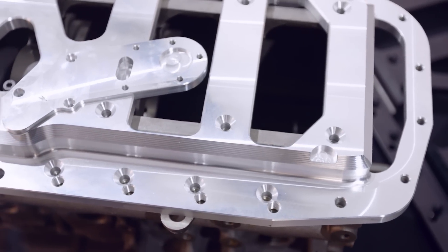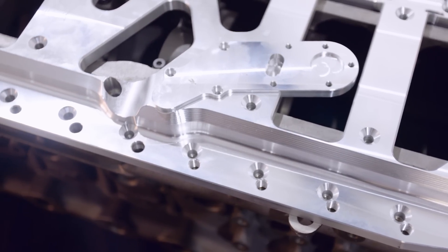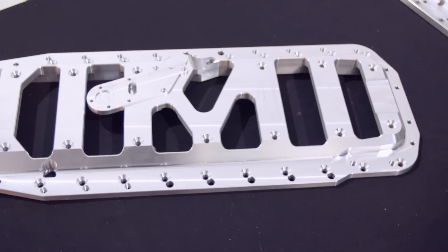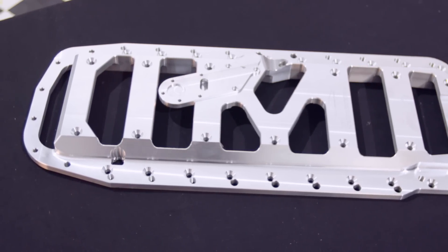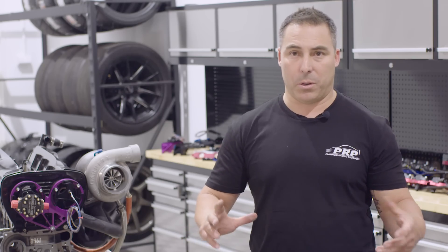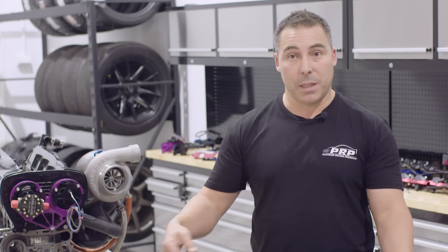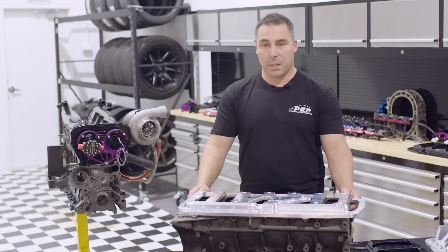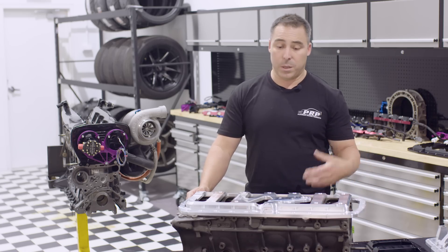Initially, we started off making this as an adapter for the four-wheel drive diff — a four-wheel drive sump assembly on the RB26, obviously to make the RB30 a four-wheel drive. After we pulled down a few engines that would cook bearings, we realized the main bearings were actually hanging in there. We thought, well, maybe we've stopped the block twist. The brace was a lot thinner back in the early versions, so why not beef that up? The brace was actually preventing the block from cracking. So there was a whole adapter, but also an engine brace that we started developing. Then we moved on to the RB26 — they crack at 500 kilowatts, you crack a block. But we stopped breaking blocks, and then we thought, oh hang on, there's merit in this. So we've evolved that and done quite a lot of twist testing.